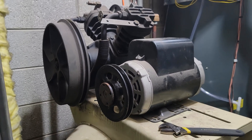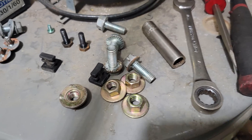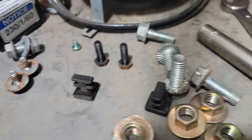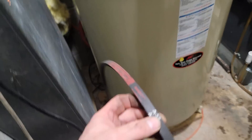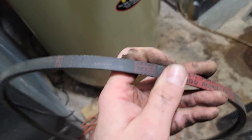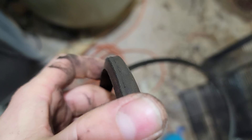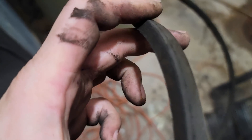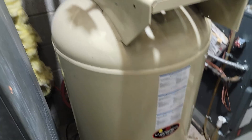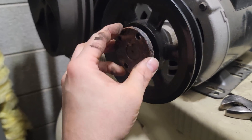The vent grate is off. Here are our parts — the two little plastic tabs and various bolts and nuts. If you're inclined to change the belt, this one is an A58 Bando Power King. I'm not sure exactly when it needs to be changed — like an automotive belt, change it when it starts cracking. This one still looks fine after about 15 years. Motors are out; I'm going to take it inside and get the pulley off.